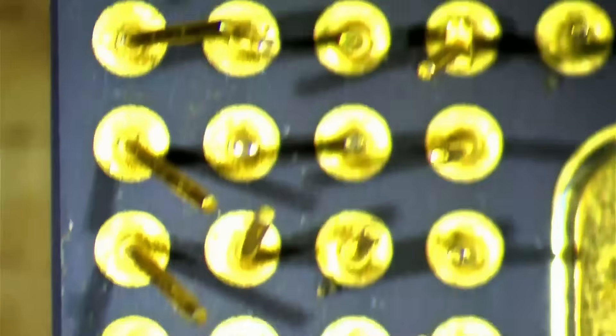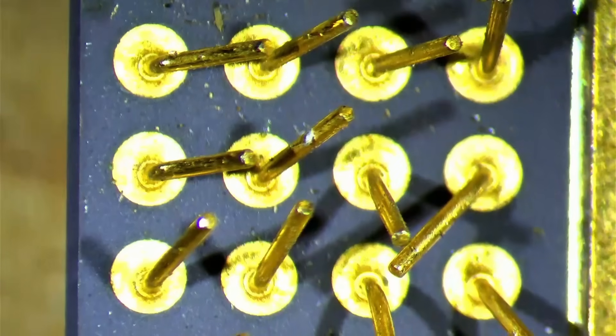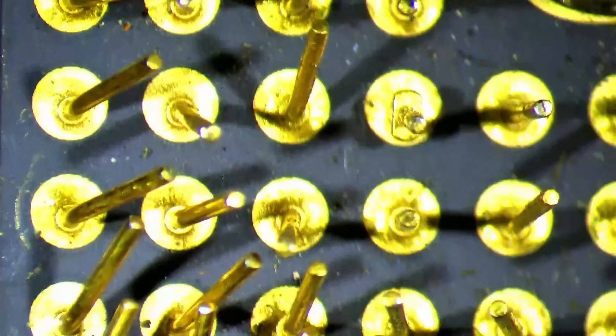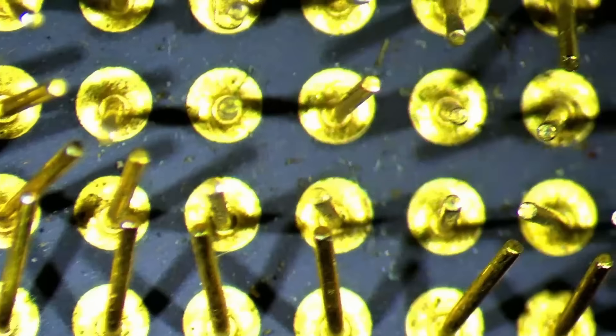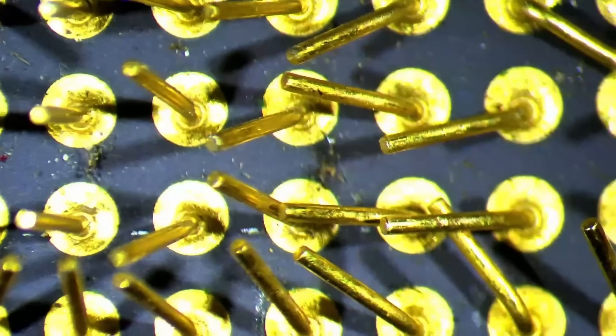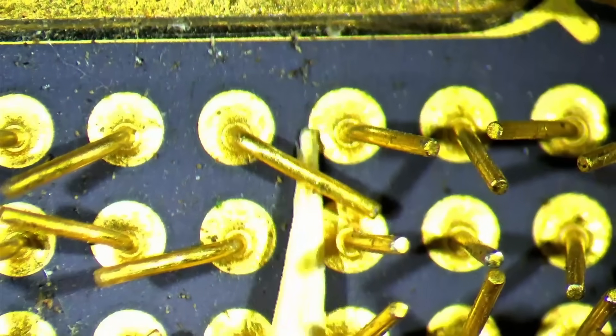As you can see, the pins are gold plated — I guess this is where the term 'golden processor' comes from. I have seen many different techniques to straighten pins and most of them seem to work to a certain degree. I have seen people using razor blades or a metal sheet in credit card form to bend multiple pins back into place. However, with pins bent like on this CPU, this technique will probably not be very efficient or simply impossible.